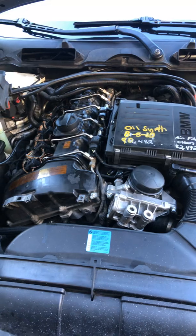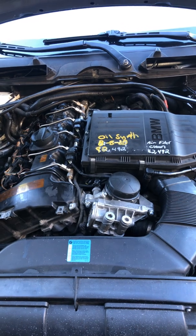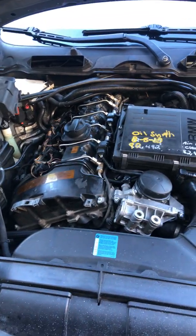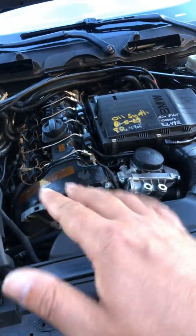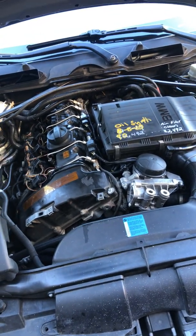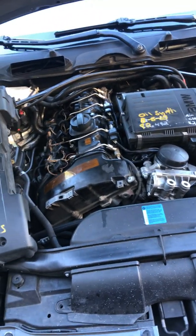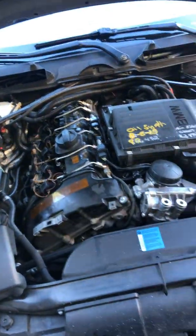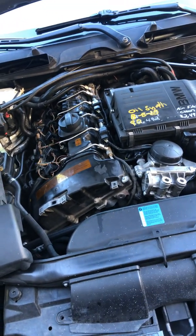So, this car for the past 6 months has been giving me some problems, and basically I'm gonna make another video and I will go through the process of trying to figure out what's going on. I'm basically on cylinder 1, which is this one here. When I start it up in the morning, I get kind of a rough idle, kind of hiccups a little bit, and I did replace those injectors already. So before you guys say, oh, it's an injector, no, the injectors are done, and I did the carbon blasting, and I changed the plug and coil. So what's left? Now hopefully it's not compression, but that's probably what I'm going to be looking at.